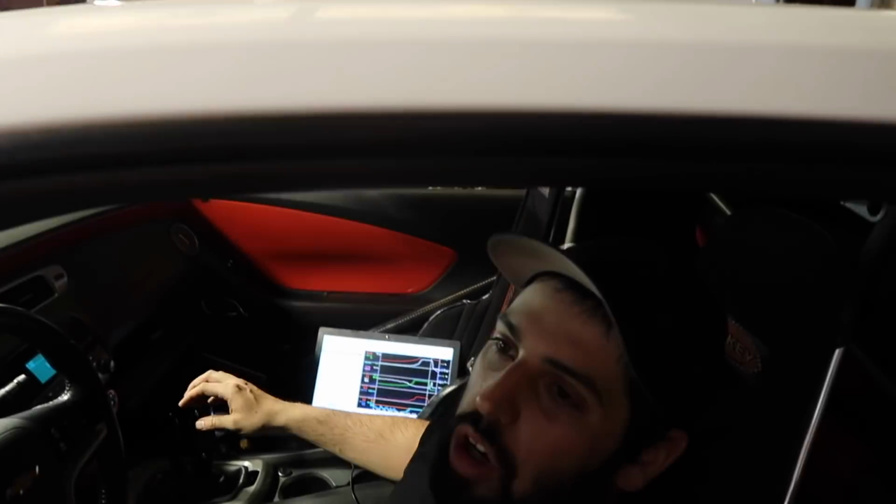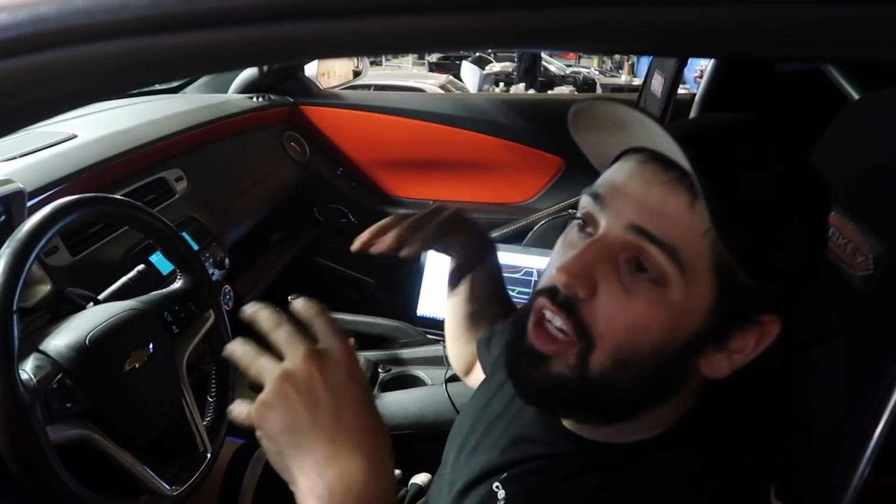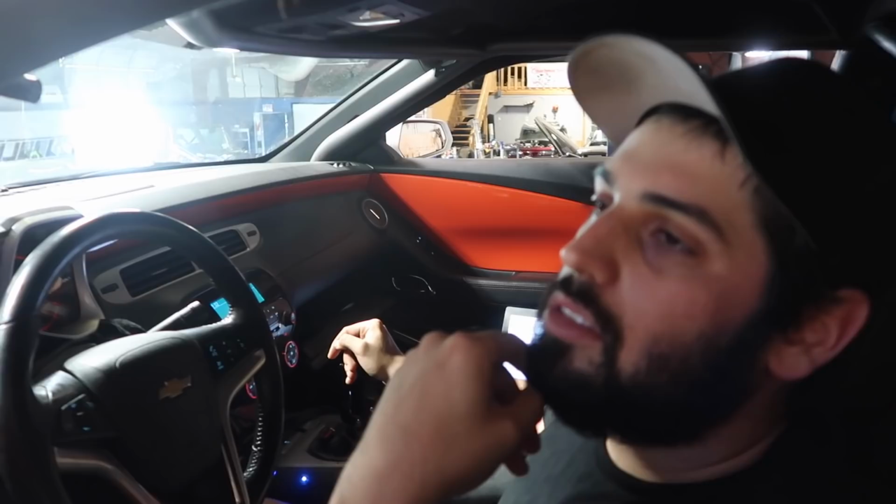Alright, well, let's go up to the booth. Alright, let me add some more. Okay. 11.9. We'll go 11.7. Okay. Well, we'll add some fuel. I think it's true, the routing of the wastegates and everything might be more efficient, might be making more power. What was the dome pressure at there? 15 on the dome.